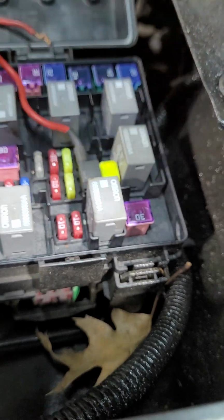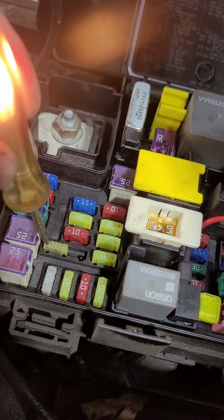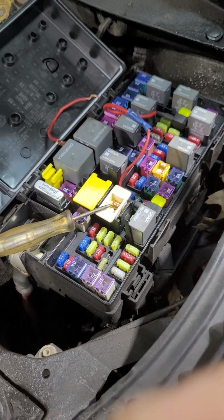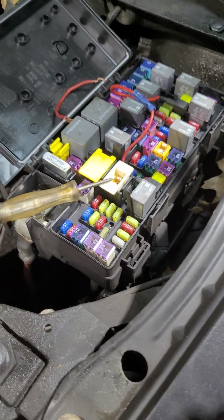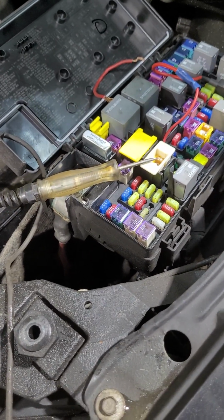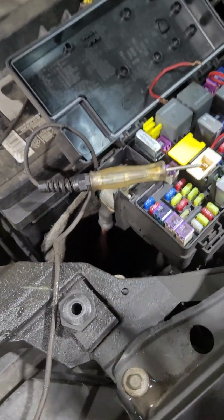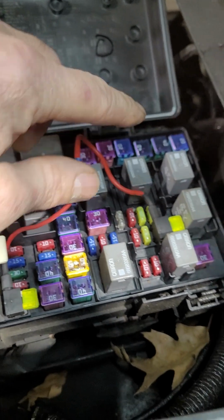So the great thing about this too, also, people that use the other fuse, it loses power when you're cranking. So if you come out first thing in the morning and you crank your car over and it's bled fuel back to the fuel tank and you just go right to crank, you don't let the key cycle on, you could be cranking this engine over with no fuel pressure and it's going to just kind of crank, kick, try to start. But until you let off the key, it won't prime itself. So this, what I got going on here, this is a much better design.